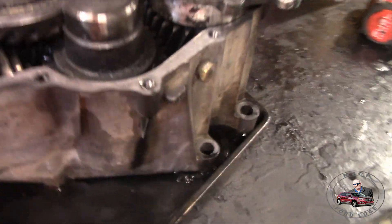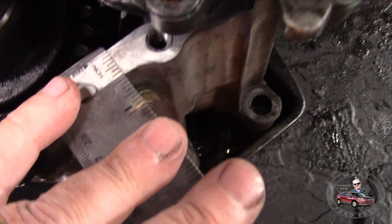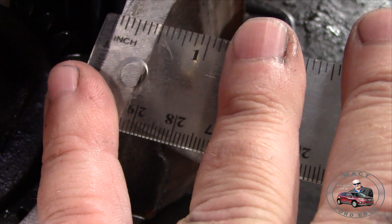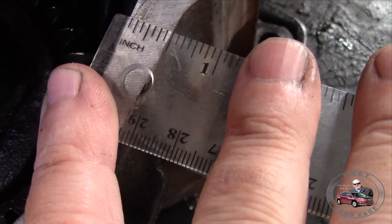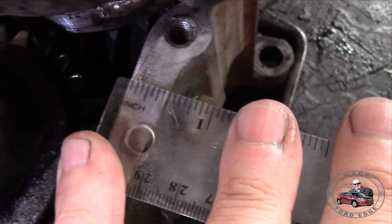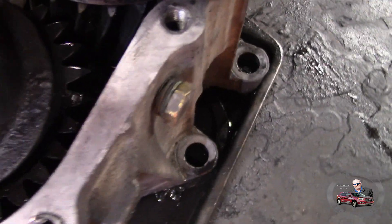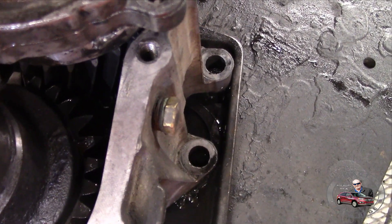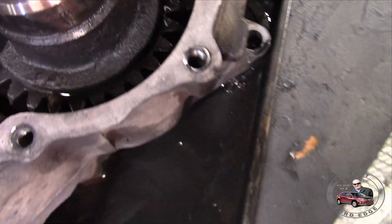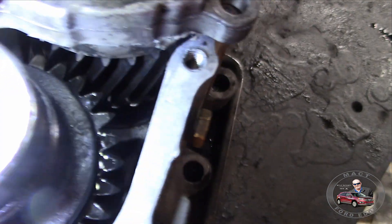We won't hit any gears as long as we don't dive too deep, but we do want to measure the actual opening for the metal. I have to find the plug right here and get the line set up. Looking at that, it is almost a half inch thick — pretty thick — which is excellent. If you go three quarters of an inch with your depth on your drill bit gauge, you won't be hitting any actual gears or anything that could cause damage to the PTU.